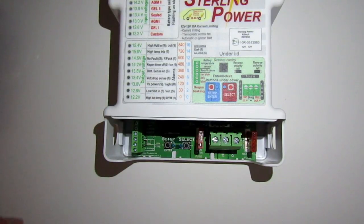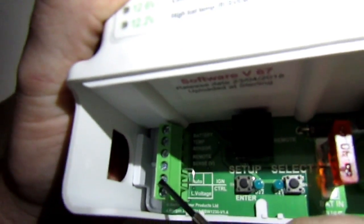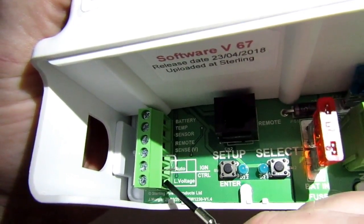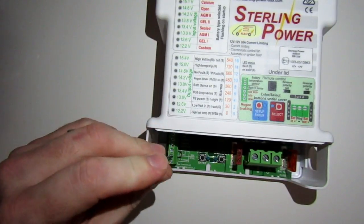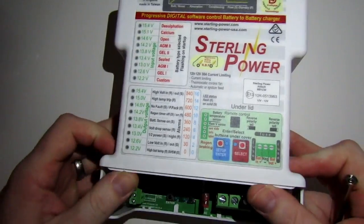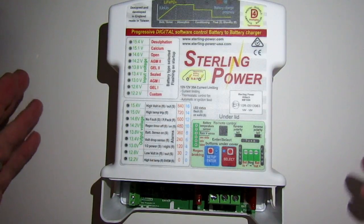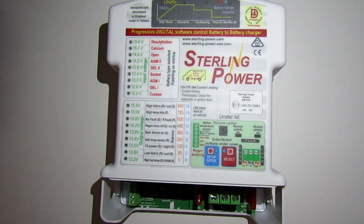For Mode 3, if you look down here you can see three points — this bridge here needs to be removed and the ignition feed goes into the bottom section. It's very straightforward to do. You take that bridge away and put your ignition feed straight into the bottom part, and then the system will only activate once the ignition is switched on, and switch off when you turn the ignition off and take your key out. We've tried it on Toyotas, Citroëns, and Peugeots, and it works fine on all three of the new van bases that we do.